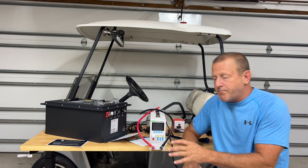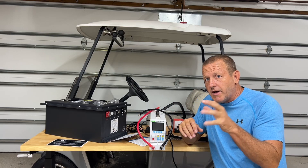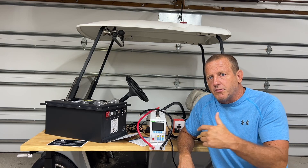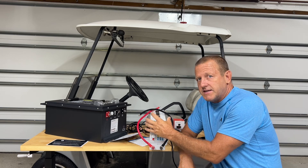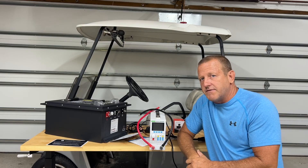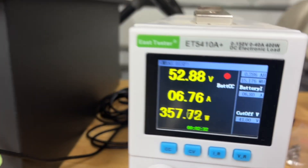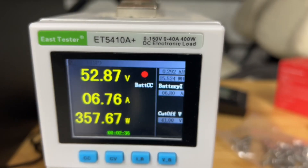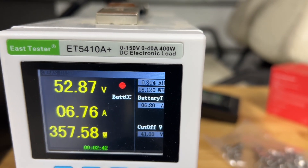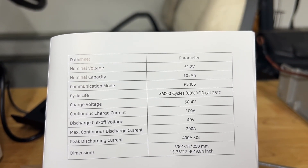We're going to be using our ET54 10A Plus battery capacity tester — a really nice piece of equipment. We do have a link in the description for this tester. This is what I've been using; it's a super accurate and super affordable piece of equipment, so if you want to test your batteries this is what I'd recommend. We're going to go ahead and set this up, start the capacity test, and see if it does have that 105 amp hours. You can see we've started our capacity test — we're all plugged in and ticking away. We're going to keep an eye on the top right; that's how many amp hours and watt hours this battery has as it runs down.